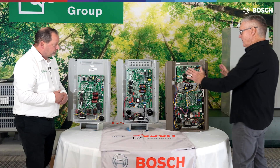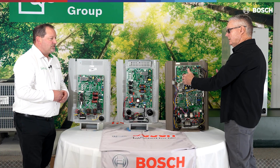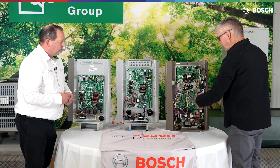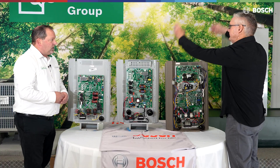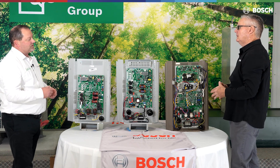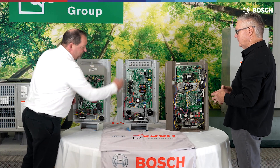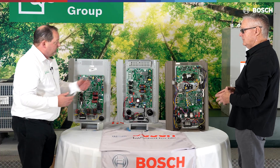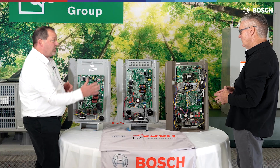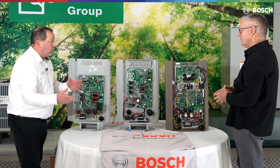What our book would call the e-box assembly or e-box accessory — I remove the top, take all the screws out, take the Molex plug, the high voltage wires, the low voltage, and slip it out. It's about a 10-minute process. It has a lot of screws, you've got to take the top off and unplug some things, but it eliminates having to get in there individually. There are some boards where we're able to lift the board off of the heat sink, but this new Ultra board is a little bit different design, and we're going to see that when we do have another board replacement style.